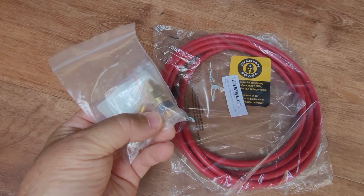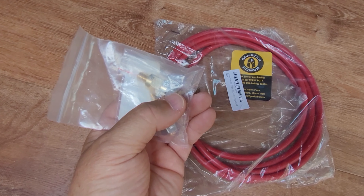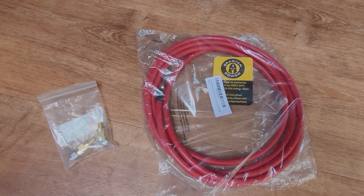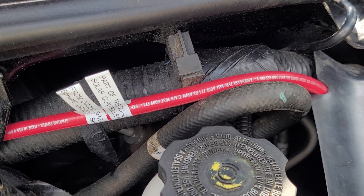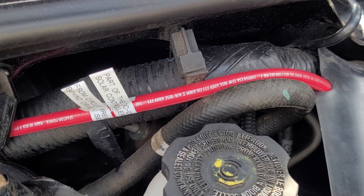The battery is a side mount, which is typical on Chevy vehicles, and I need some way to hook the end of this cable onto the battery. That's where these brass lugs come in. This will screw through the existing battery terminal but give me a stud to hook the other end of this cable to. That will complete the electrical connections, and while I'm driving this will throw a charge into my solar batteries, and vice versa — it will also allow the DC to DC charger to throw a little charge from the solar into my starting battery.